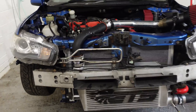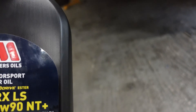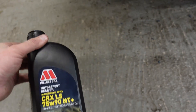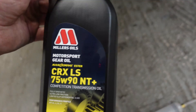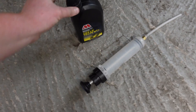Before we actually go to the car, we need to make sure we've got the right oil. Now you can't just use any old gearbox oil, you've got to use the right stuff because these transfer cases have got clutch packs in and they have certain friction modifiers. There's all sorts of complicated reasons why you have to use the right oil. Now this is the oil that I'm using — it's what a lot of people in the UK use because this oil is made in Britain. So that's the oil that you want to use.